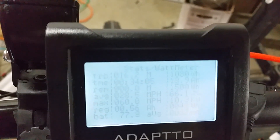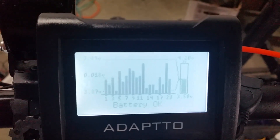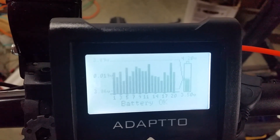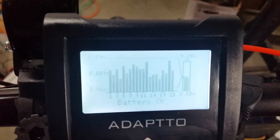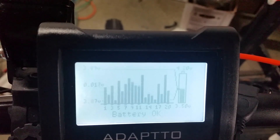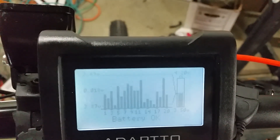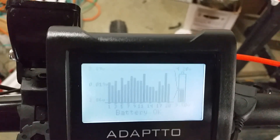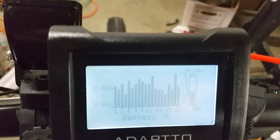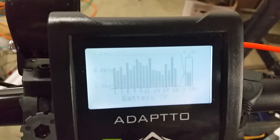Battery voltage on the bottom. If you press the right button again, this is your battery cell voltage — your 20 cells. You have a 20 cell lithium battery. Down on the left of the screen, you see the low range of this display. Currently, the low end is 3.87 to 3.86 volts and the upper end is 3.89. In the middle, you'll see the voltage variance of the cells — we are at 0.019 or 0.020 volts, that's the variation from low to high of your various cells.